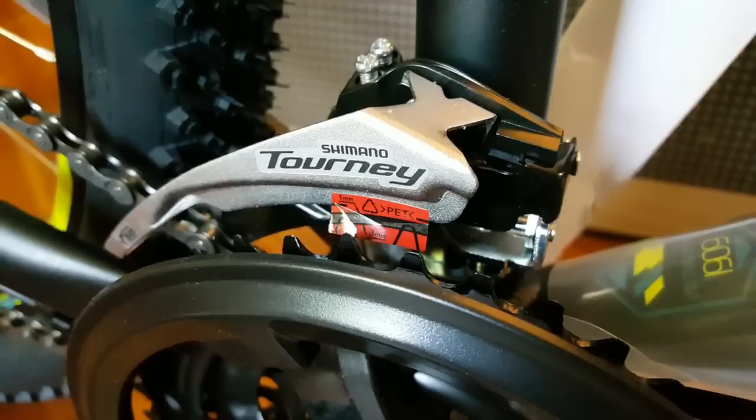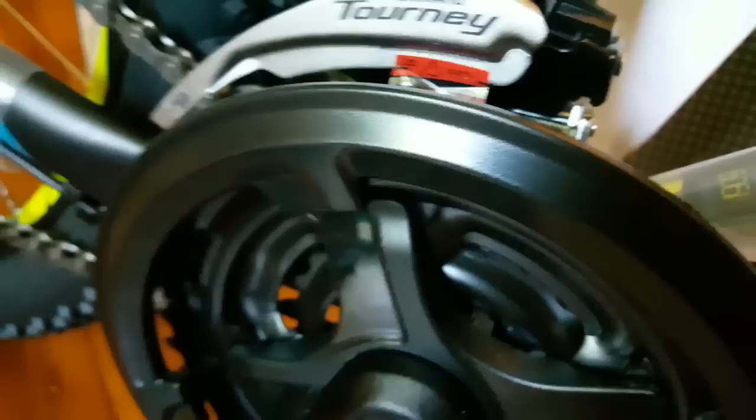We'll flip the bike upside down and let the crank do the work to get the pedals on. There's a red alignment tab on the derailleur — I'll keep that on so when I align the derailleur I'll know what I'm doing, because I can already tell there are some spacing issues. This is going to be your high adjuster and your low adjuster. GT's triple triangle design — yeah, GT's famous for that. Sharp looking bike, those tires look gnarly. It does have Presta valves if you're not familiar with them. The suspension is a SR Suntour XCT — not a RockShox unfortunately, but it's there.